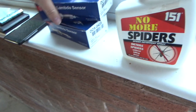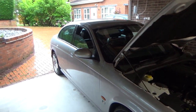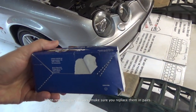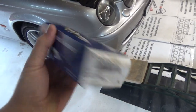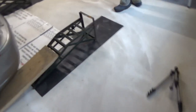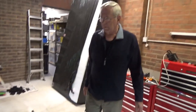So today's challenge is the upstream O2 sensors from a 2003 S-Type R. It's only on one side, but the recommendation is to change both — change the pair of upstreams. These were the Denso ones and I think they were about £80 each. So the general plan is car off on the ramps, and wait until the exhausts have cooled off a bit so that we can actually remove the sensors.